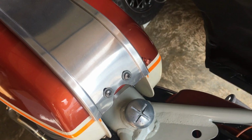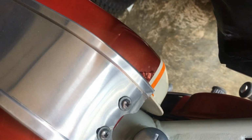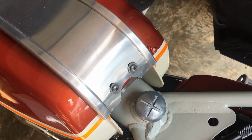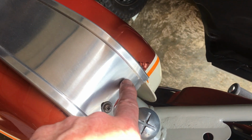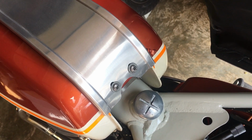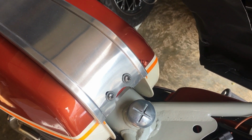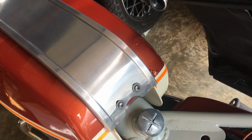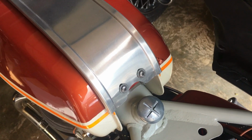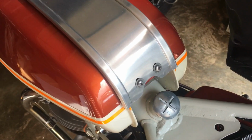So I've drained the tank, and I'll let the tank dry out, and then once this is dried and stabilised a bit, then we'll take this off and see what's under there. At first I was thinking that it might be one of the blind-ended stubs for these screws, but it can't be, because it's the other side of the seam, so I think that's the seam leaking. But then what I don't understand is why it didn't get any worse while I was faffing around trying to get containers, etc., and unscrewing petrol pipes to drain it. So anyway, we need to investigate that.